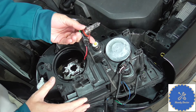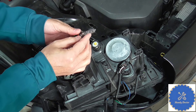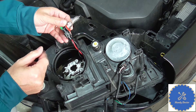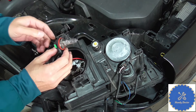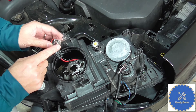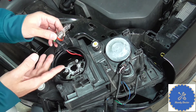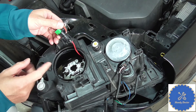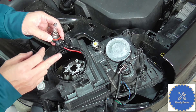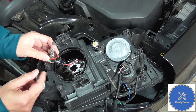Now it could be the light bulb that's broken, but looking at it, the connector and the wires are perfectly good, so it may or may not be. By the way, if you don't know, this one runs at super high amps so it produces a lot of heat. In many cases it is the connector that actually burns, and this is a typical issue for many cars.